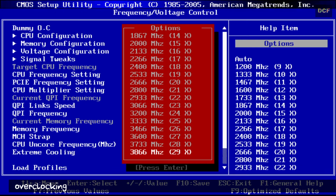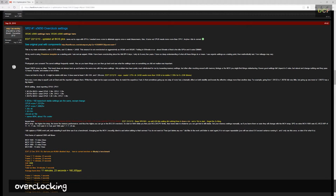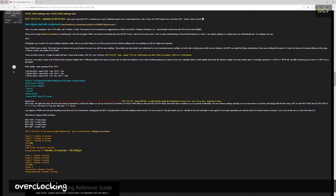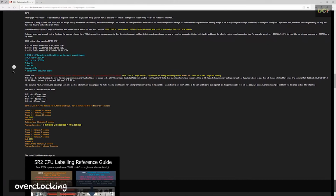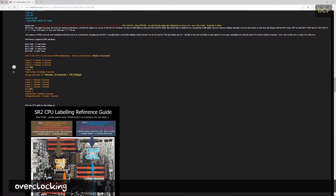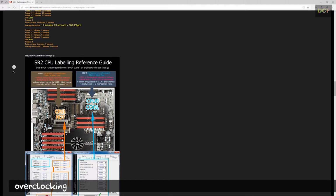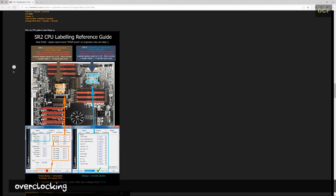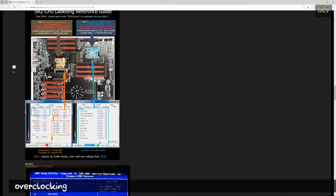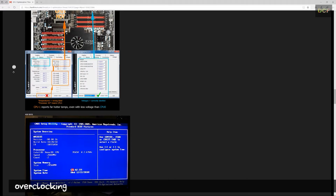What's good? These Westmere CPUs have good overclocking capabilities. It's a lot of trial and error to overclock the system. I did some research and got the CPUs to 4.33 GHz with a base clock of 197 MHz and a multiplicator of 22. At first I was surprised how easy it was. I made some CPU benchmarks and was impressed. Then I wanted to know what the system is capable of in games.